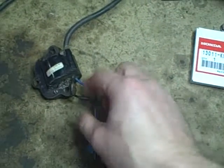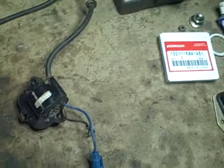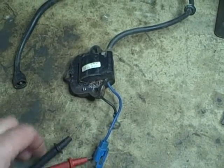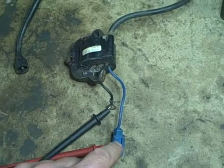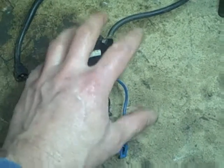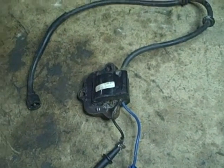I'm going to set this aside and look at the ignition coil. To test the ignition coil, there are a couple of quick tests that are easy to do and can be good indicators depending on the results. If I go from this blue wire to this black wire, I'll be checking the resistance of the primary winding. I already did that and found it was less than one ohm, which is normal. If I had found infinite resistance or an open circuit, that's positive proof the primary winding is open and the coil is bad. The fact that it's not open doesn't necessarily mean the coil is good, but it's one positive thing.